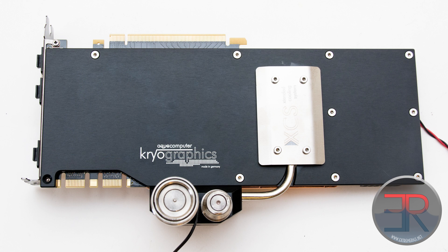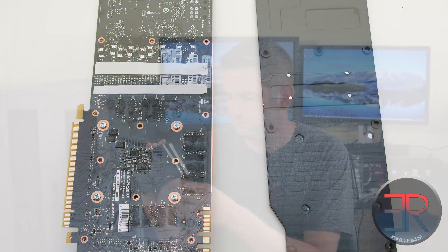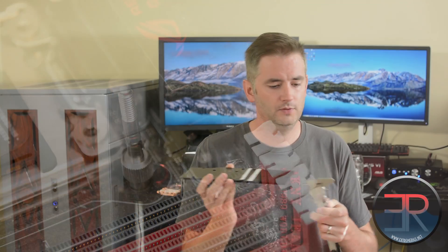On the back - the part that actually touches the card - you'll see two thermal pad strips that give extra cooling to the VRM section. You'll also notice not all of the machined areas go all the way through, so some of the mounting screws are hidden, and we like that - we don't like every screw to come through the back. Now the thing to notice regarding compatibility: you can see this is still quite thick for a backplate, and there are also these little plastic standoffs. So this backplate on its own, whether in active or passive mode, still has compatibility problems. Let's measure it with the calipers.